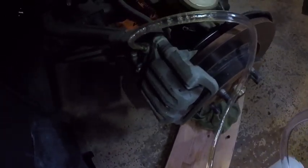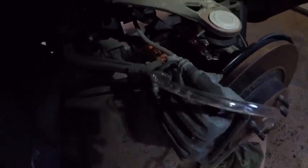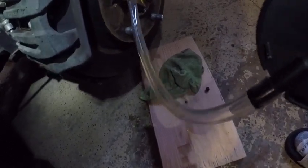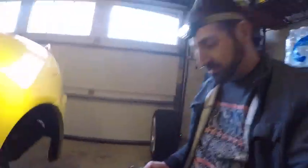If you get any brake fluid anywhere, this stuff is highly corrosive — clean up that mess right away. As I'm pumping it out, you can see it coming through. You open the bleeder valve about half a turn counterclockwise and the fluid just comes right out. When it turns golden like this — see how golden it is — that's what you want.